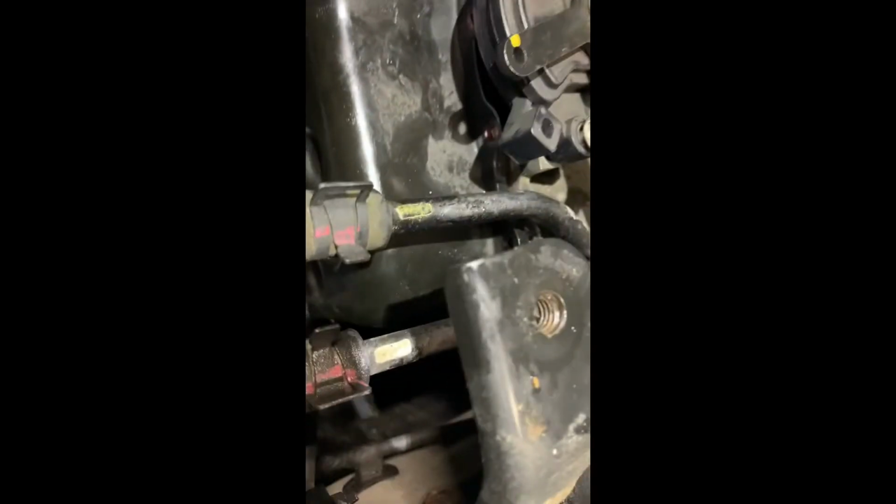Don't worry about any of this if you're not doing the harness. That'll be if you're doing the harness portion of it. That'll be a separate video. And you're gonna remove this 10, make that harness mobile, and either run it up or jack. Now, once you're grabbing your jack and you're getting ready to go up, take those top bolts off, okay? Get all your bolts up here out of your way while you're leaning over the car. The rest you'll have a good angle to get to underneath.